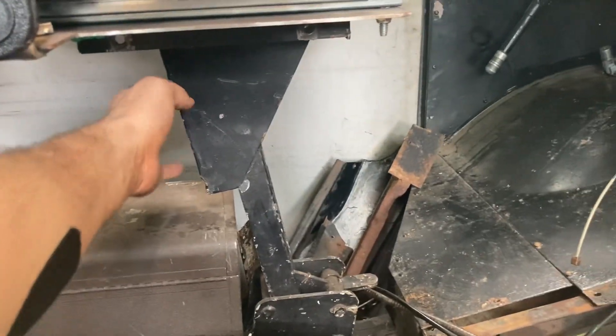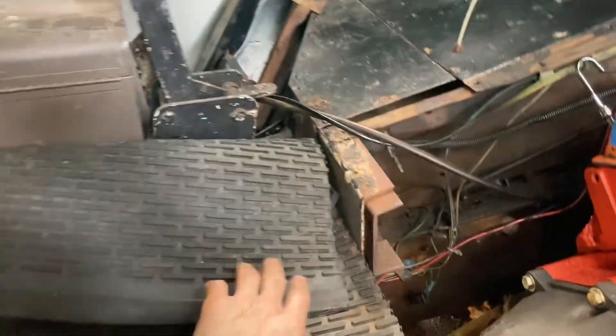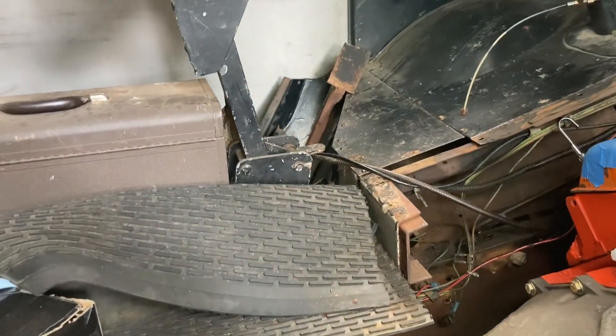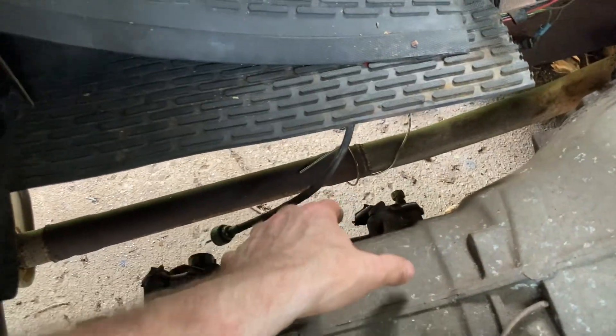I want to get that shifter up high. I'm going to have it set up so it kind of pulls up against this, but the seat needs to be able to rock forward. Because it's going to be so tall, I don't want it rocking. This floor may kind of rock a little bit — and it may not once I put the crossmember back in. I need to get the shifter set, because that's the thing about spinning the torque converter and the flywheel — I need to make sure I'm in park or neutral. I don't remember exactly how this works, but when I try to spin that I don't know if it's going to try to turn the driveshaft.